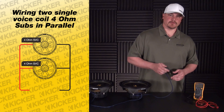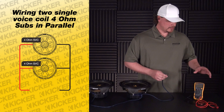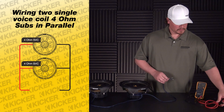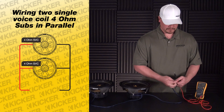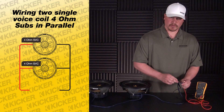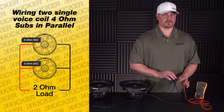This will be my speaker lead to my amplifier. To help you determine what amplifier you'd want to use, take a simple multimeter digital meter, switch it to our ohm settings, take our leads — the blue wire which is our positive to the positive lead, negative to our negative lead. This meters out to be a two ohm load. Both these subs are good, so I'm going to look for an amplifier that's two ohm stable.